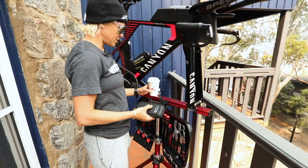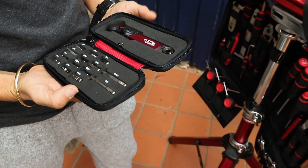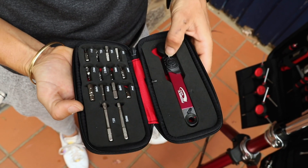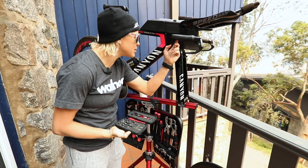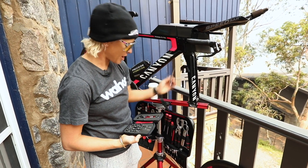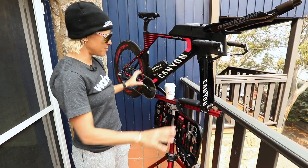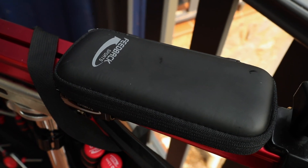One thing that's really important when traveling, if you can't take the full setup, is a little ratchet set — one that has both Allen keys and hex keys, and possibly even one with a torque setting, so you can access any part. Under here there are some bolts, and if you're using a larger Allen key you have to dismantle the bike a bit more and it'll hit the frame — so these little ratchets are good, they fit in any spot. Make sure you always travel with something that can deal with any part on your bike, and there's some pretty cool compact stuff out at the moment that's easy to travel with.